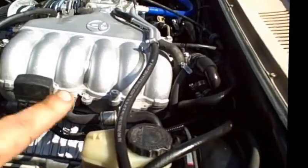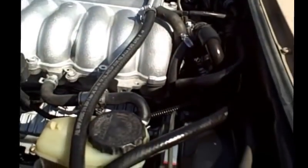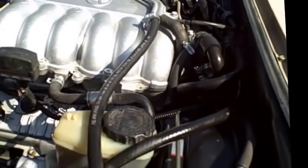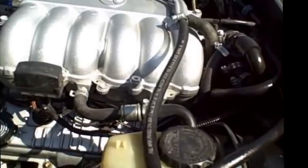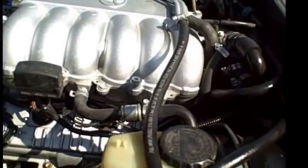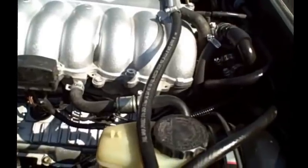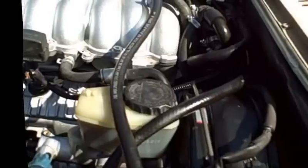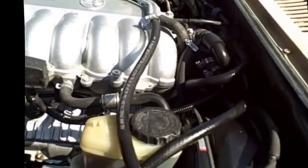The reason behind it, I guess, is the distance between the shaft and the flywheel is going to be a little bit different. So when it actually gets pushed up against your pressure plate, it's not going to be the right distance. So anyway, that's what you're going to need when considering a clutch.